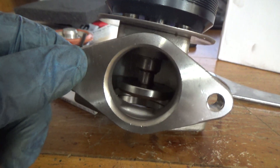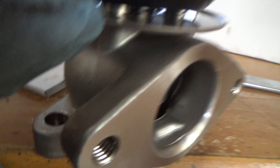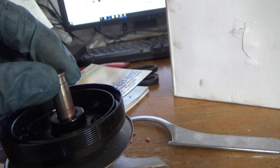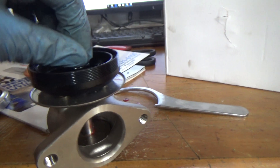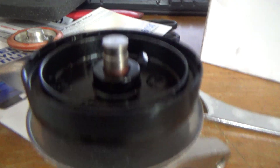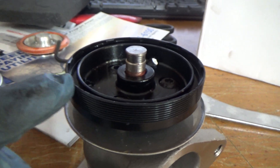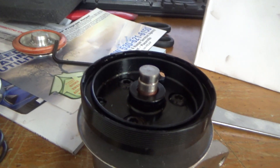Put the shaft back up into the housing. Set down your base plate. Set down your spacer washers over the threaded holes. Drop the bottom of your wastegate on — it will automatically align everything. Once the wastegate is lined up, we can go ahead and get our diaphragm put back inside. The way this diaphragm seals is on a compression basis, so as long as this gets tightened down all the way, it's going to compress and seal inside this groove.